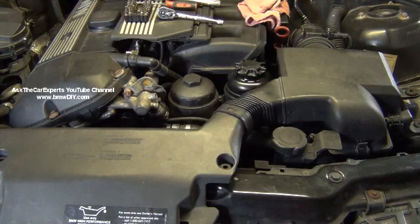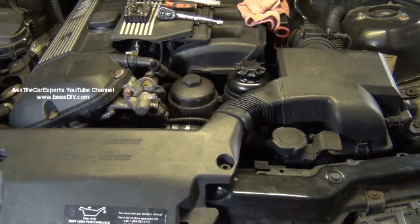I'm going to go over replacing the intake camshaft sensor, which is a common P code — P0344, circuit A — which is an intake camshaft sensor fault on an M52TU or an M54. This could be on a 5 series or a 3 series. This is actually for a subscriber who has an E39 530i with the P0344 fault, and circuit A is for the intake.